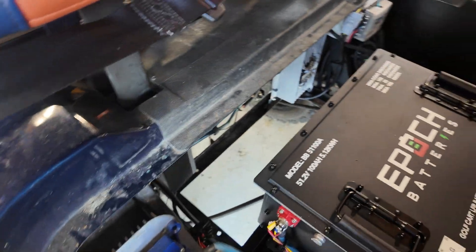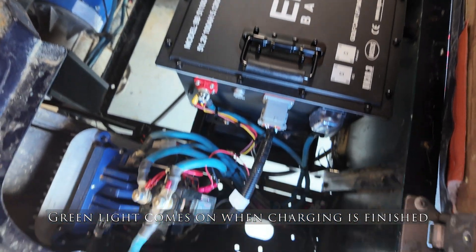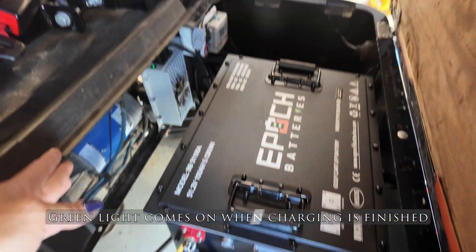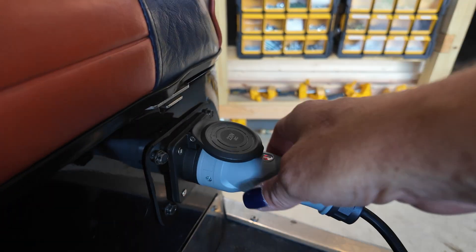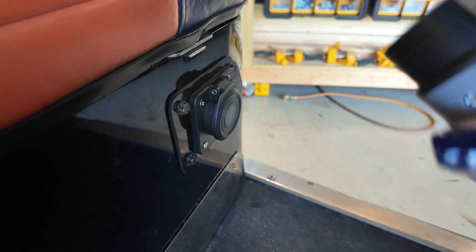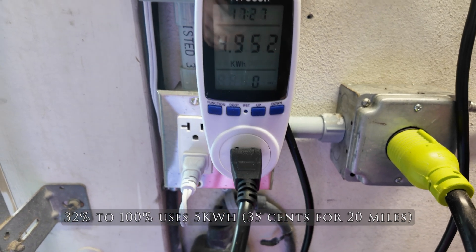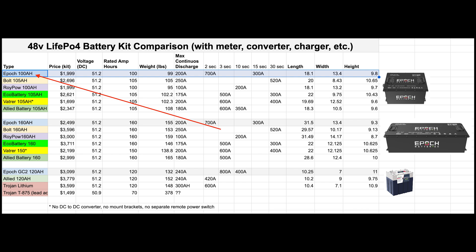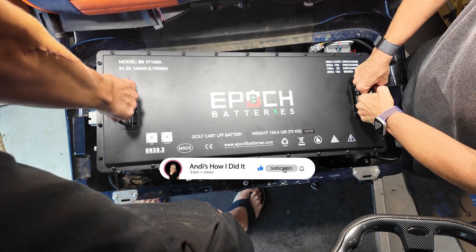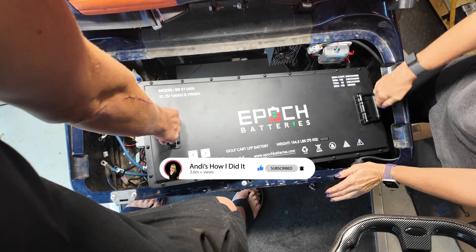Once done charging, you'll see a green light on top of the charger letting you know it's finished. The battery is back to 100% and I can unplug it and take the cart out again. It used roughly 5 kilowatt hours to go from 32% to 100% — that's basically 35 cents in my area for about 20 miles. You can't get anything near that with a car, so it's a great cost return. I also tested a 160 amp hour battery, which is coming in my next video, so if you haven't liked and subscribed, please do so and I'll show you exactly how many miles I get from that one.